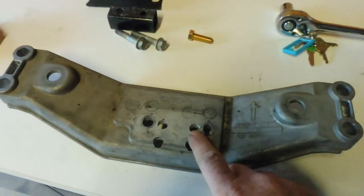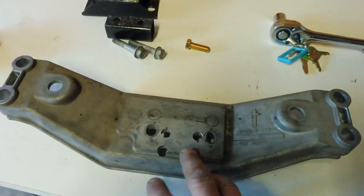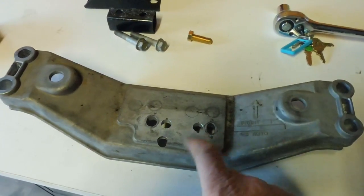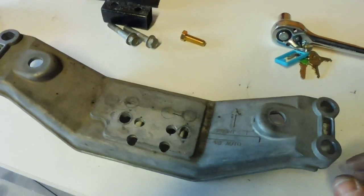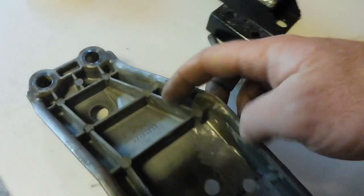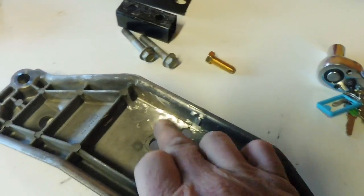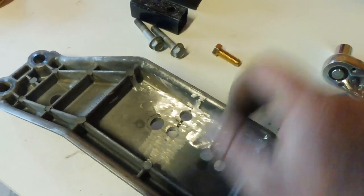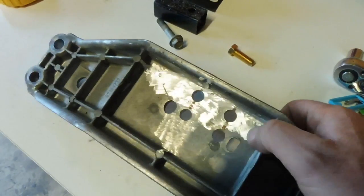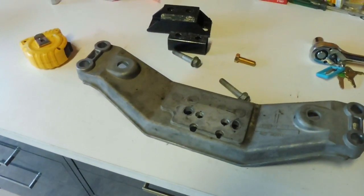Okay, you can see the mount. They're those original holes that I had marked, I thought was going to line up, made the mistake, and then remarked it, and they're all the way back here. Now they are right on the edge of that pad there, which does worry me a little bit, but we just persevere and we can make something work. But also what I had to do to get them bolts in there, there was another rib like this that went all the way across here. Now I got in there with my grinder and my Dremel grinder, cleaned all that rib out so that these 2 bolts could go in there without the heads fouling. So I had to grind that out to make it work, and I'll quickly assemble this and I'll show you what the next problem will be.